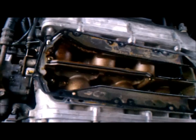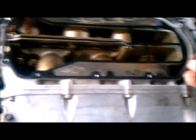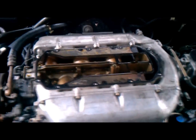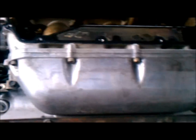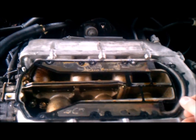Here are the EGR ports — there's one there, one there, they go all the way around. They're dirty inside but not clogged. But if you put the gasket back in incorrectly it completely covers the holes. Flip the gasket upside down and you see how they all line right up. I wonder if this technical bulletin existed because at the factory they were improperly installed.